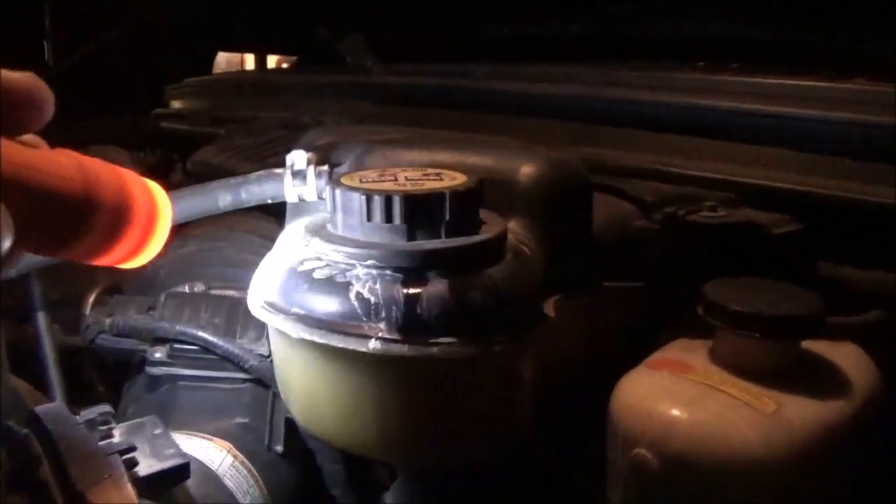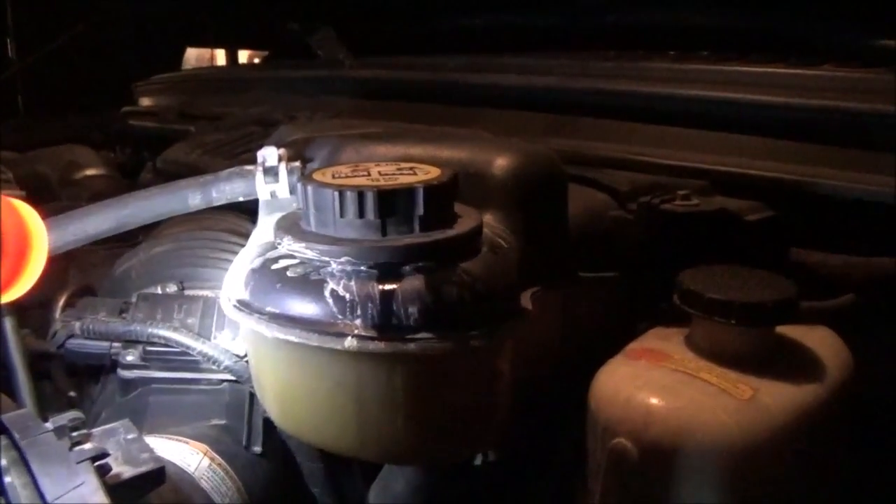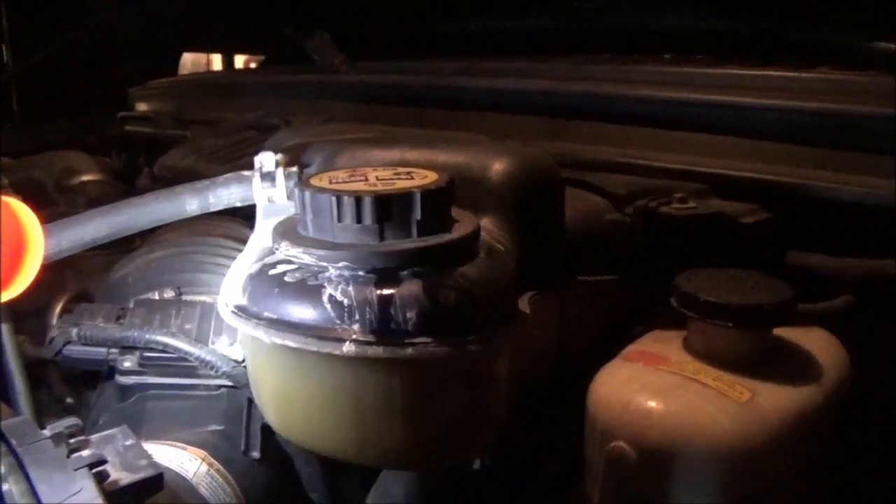When I'm looking at it, you can see this around here — before I bought it, somebody was going to have it put in a stop leak. So then I was really worried. I got a pretty good deal on the truck but looks like I'm going to go ahead and have to bring it in. I put more coolant in there and I got some stop leak just to get me by, but you have to wait until the motor gets up to temperature before you dump that in.